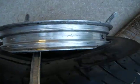You can use a 5-pound beater sledgehammer if you want to. I've done that before. But if you hit a rim, you're done. It's over. And you just smack it a couple times like this. Now what's going to happen is while you're smacking, you're pressing down. Now let me show you this. Just that little tiny bit of wrapping. Look how far out they've already increased this. See that?